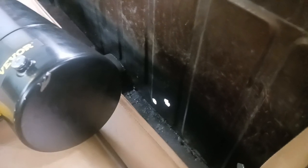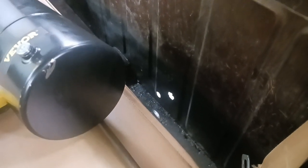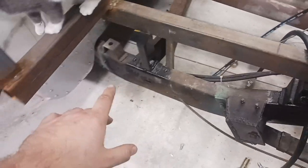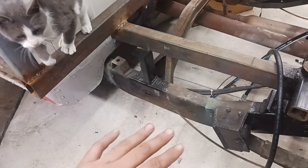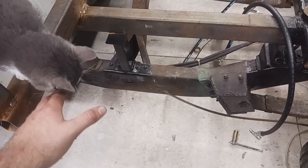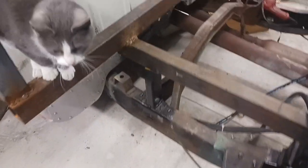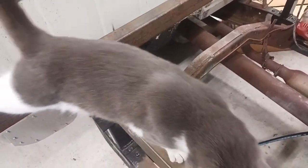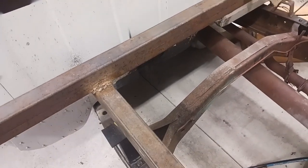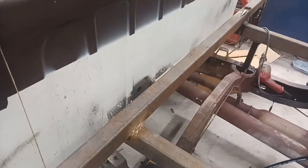If you're installing one of these on something you really care about, maybe take a little more care in how you drill holes for your inlet and outlet. For me and serviceability, this thing is going to sit around quite a bit between usages. I'd rather not have our cheap pump on the exterior underneath. I thought about mounting it along the frame rail, but Jeep trucks sit a little low to the ground — the likelihood of knocking it off on a stump or in a rut would be pretty high. Even inside the frame, you're still getting mud thrown up on it. It needs to be in a little shelter, so we're going with inside the cab.